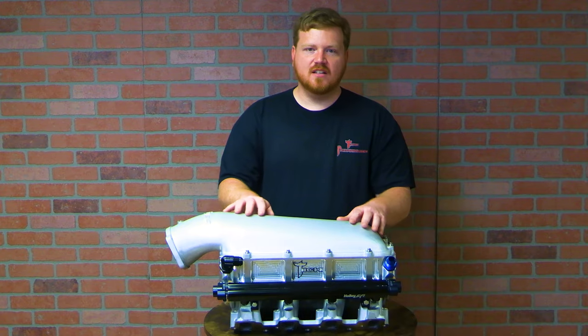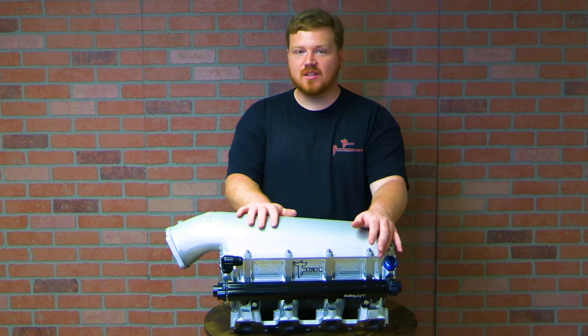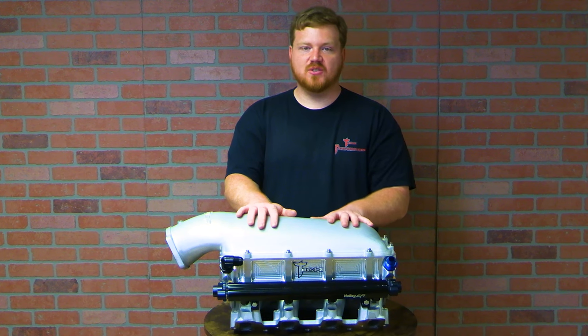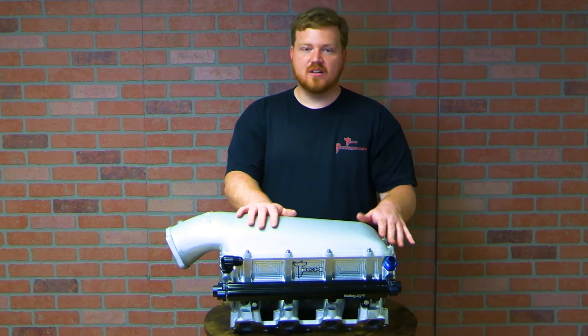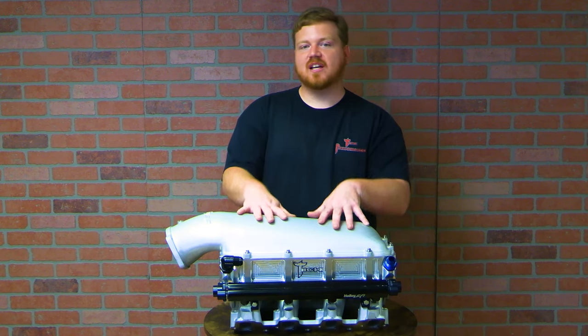With this new design, it becomes the shortest one we make as far as added height between the base and lid. It still carries that 3-inch core thickness just as before, but packages better. We're now at 11.82 inches total — a significant decrease in height, packaging better than even a high-ram manifold by itself when used with the low-ram manifold. As always with our in-house products, we source everything we can in the United States, including the raw stock we machine parts from. The core is manufactured in the US, and even the hardware — we use ARP hardware manufactured at ARP's facility in the United States.